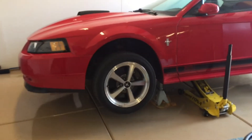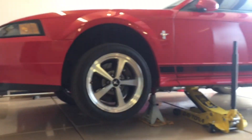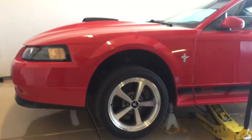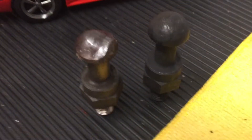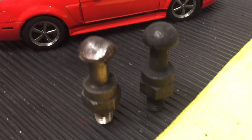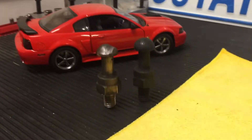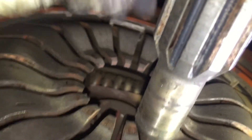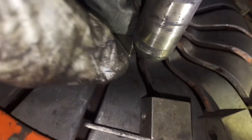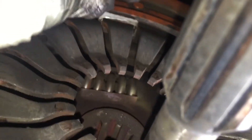In the end I did start removing the transmission. I've done that job several times and I have a transmission jack. You can see the difference on the pivot ball stud — the one on the left was completely trashed, so it was good that I pulled it apart anyway to change those other parts. I removed everything in there. You have to make sure that none of these parts fall down and go inside the clutch, so be really careful as you remove them — you might want to use a magnet so nothing falls down in there.